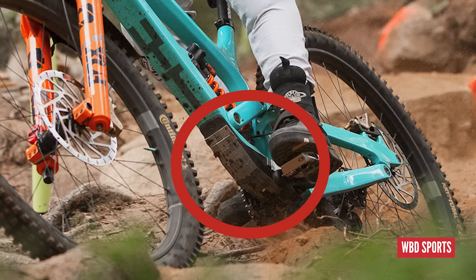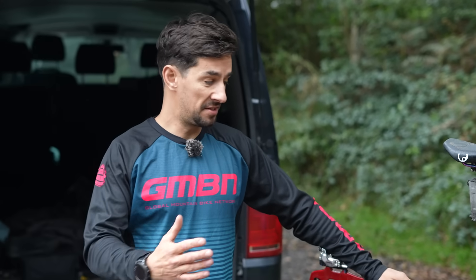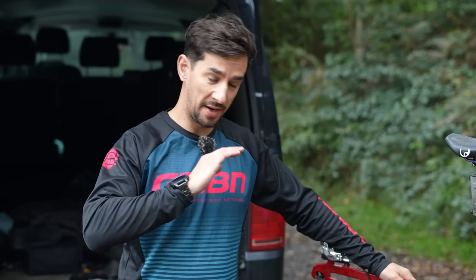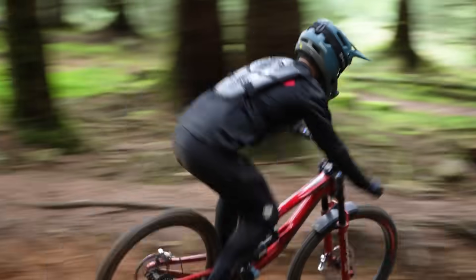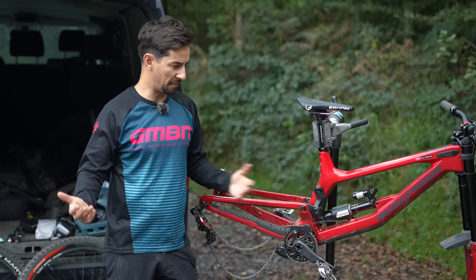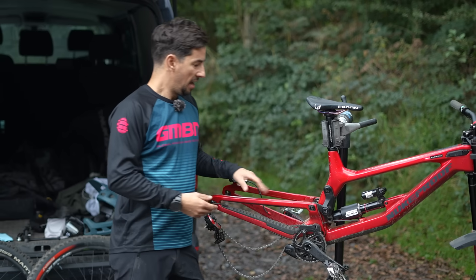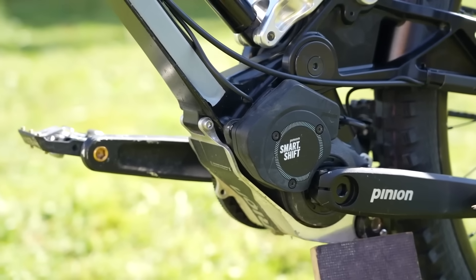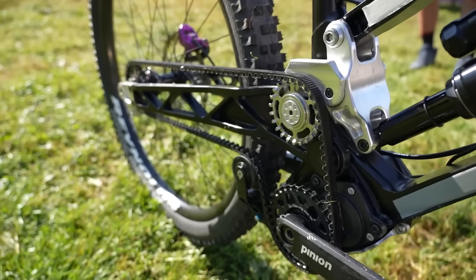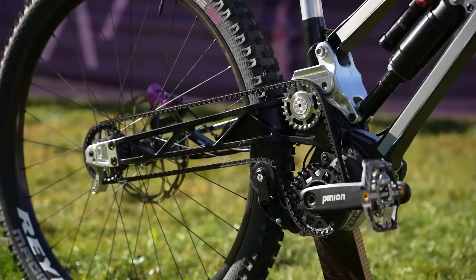On the pro bikes, they get the weight as low and as central as possible, and that often means on the main frame just in front of the bottom bracket — getting that weight low is great for bike handling. Momentum is good for some tracks, for rougher tracks where you'll go in fast the whole time, but it's not good for starting or stopping. So often you'll see pros take these weights off if the tracks are tighter or in the woods. One of the advantages you hear about gearbox bikes is that you take the weight from the swing arm and put it onto the middle of the bike — but then it also becomes sprung mass as well.